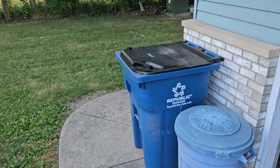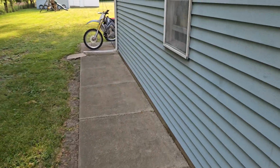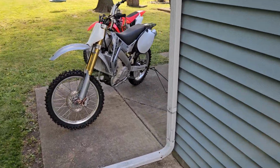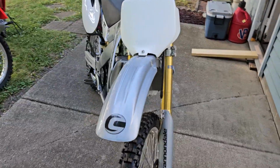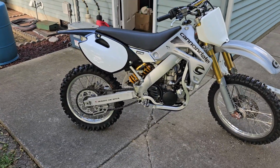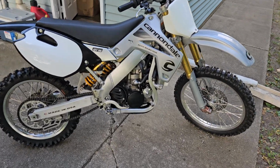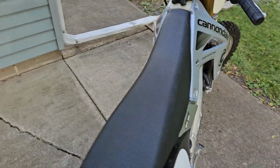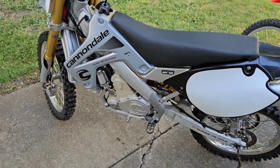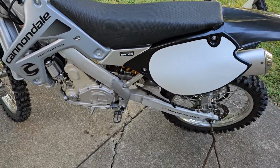So, where I left off was I was able to get the engine to turn over, but it was just going slow. It was really laboring, and it's just not right. Plus, I couldn't get the fuel pump to turn on anymore. So I have absolutely no clue what the heck is wrong with it. But I'm guessing it's engine related, and I guess there's a chance that I could have smoked the fuel pump by running it, having it starving for fuel. You know, having to strain so hard to get through the petcock. So maybe that's all it is. It's just a fuel pump.